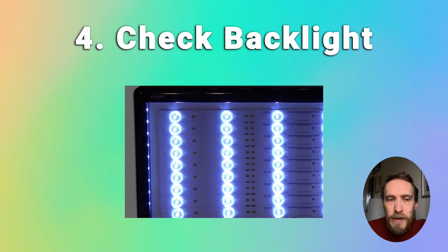I've linked some other videos on how to replace the LEDs, but it should be pretty obvious once you've got your TV open, and you can try a backlight tester. But once you've got your TV open, you can get a couple of standard AA batteries or 9-volt batteries and make a simple circuit with a couple of pieces of wire, and try each LED in turn. You should be able to provide enough power to power each LED using the battery. And then that will let you check whether the LEDs are giving off blue light or white light. And if the light is blue, then they need to be replaced.